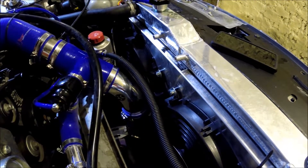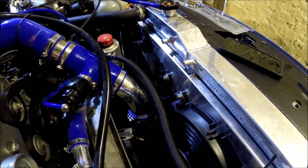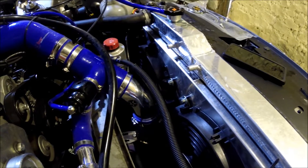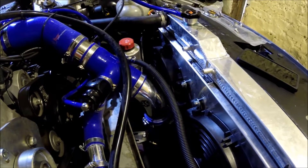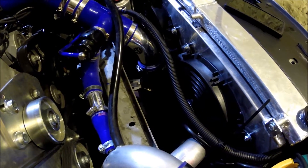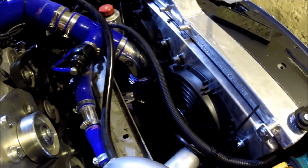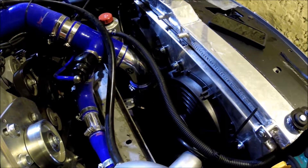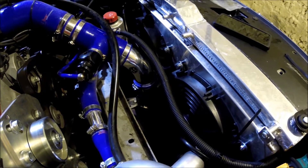My opinion is you're probably better off going on eBay and buying a shroud on its own from a no-brand manufacturer - I found one for £110 rather than £180. I'm going to bin the fans on the Mishimoto unit and get some Comex ones which will flow significantly more and pull about 9.5 amps, giving much better cooling performance. The shroud does benefit by forcing air through the whole radiator, but I wouldn't spend the money on the Mishimoto shroud. It's convenient that it plugs directly into the OEM wiring, but it definitely flows a lot less than the OEM fan, so you could suffer from overheating issues. Hope you've enjoyed this video - make sure you subscribe and like to see more.